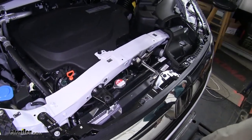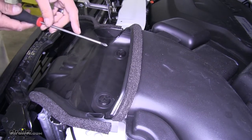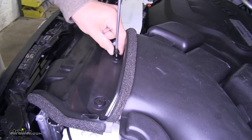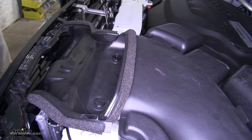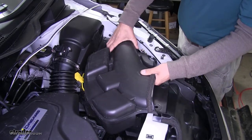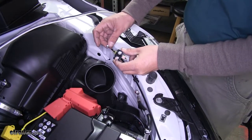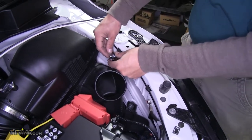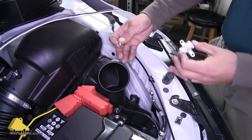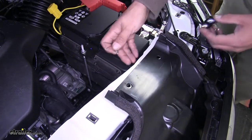There's going to be two push pins holding our air box in place with Phillips heads, so grab a Phillips head screwdriver and loosen up that center section until it comes out. Then grab a flathead screwdriver or trim panel tool and pop the outer section off. Do that for both push pins. Now lift up slightly and work it back and forth — there is a little rubber seal on the end — and it'll pop right off. To mount our breakers they provide self-tapping screws. Even though we took our air box off, if we come right to where that air box sat and come right behind it, we'll have the core support right here where we can mount our breakers.